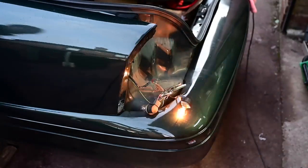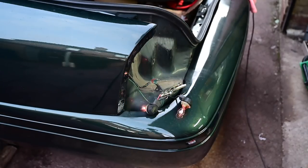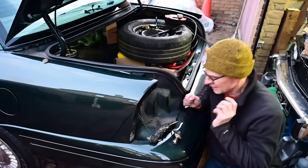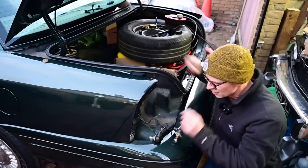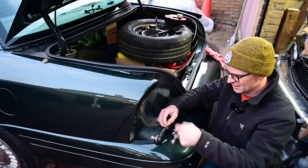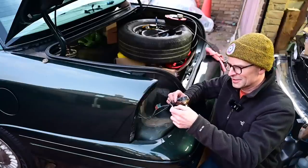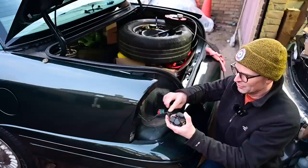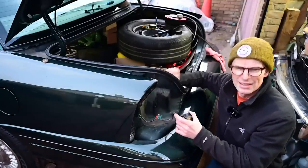A quick proof of concept to make sure I've done the right thing: only that one is indicating, which is correct. Is this going to come up with a brake light? Yes - both bulbs are coming on, which means I've done a fix! Now I need to run a second spur from here to the second bulb and cut that as well, giving both brake lights coming on just from the green wire feed. Then I can take the feed from one of these indicator bulbs and run it to the new bulb sitting in the bottom.